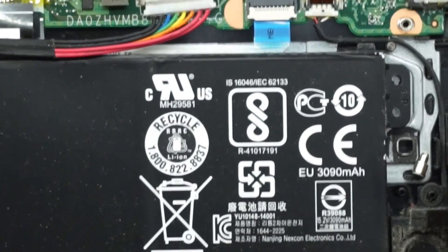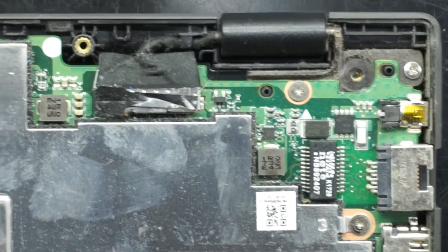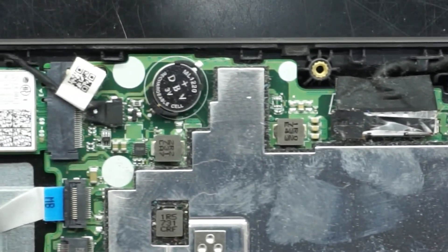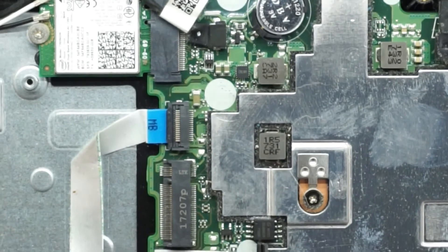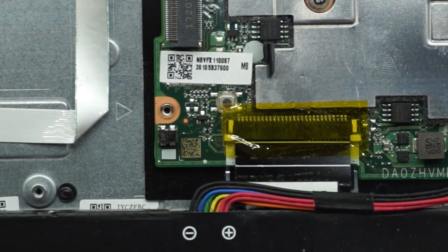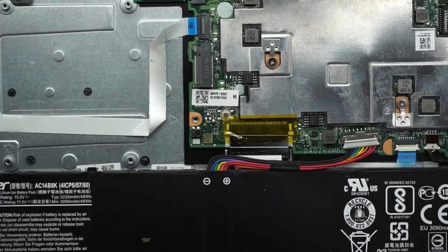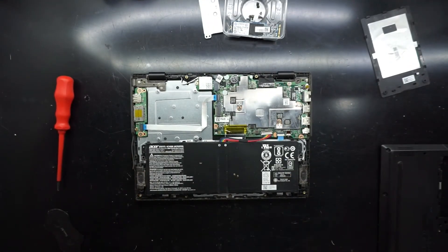The battery is at the front of the machine. Zooming up we can see a few more connectors, the LCD connector, a small CMOS battery, and a PCIe WiFi card. Going down we've got the M.2. One key thing to note: the RAM on this particular model cannot be upgraded — what you see is what you get. The same applies to the processor, which is passively cooled. Anyway, that's just a quick overview of the Acer B118 laptop. Bye.